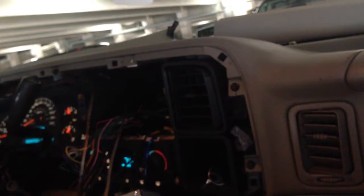I've got the glove box open. I'll cut off two pieces of speaker wire that will be long enough, and I will tape them together and feed them from up here, and hopefully I can reach in the glove box and grab the other end and take it on over up into here and feed it through. So I'll estimate about how much speaker wire I need, give myself some extra, and go ahead and run those. Alright, so I just took this, pulled that over, and then allowed my glove box to drop just a little bit. Held it with my leg to keep all my contents from dropping out. And I was able to reach in here and fish that wire in through the top.